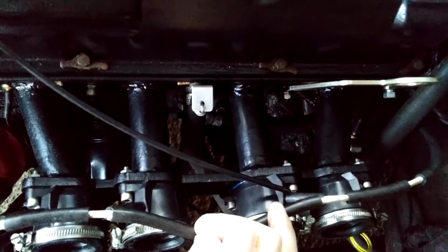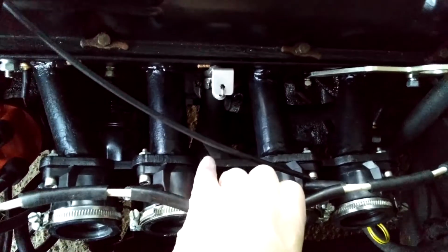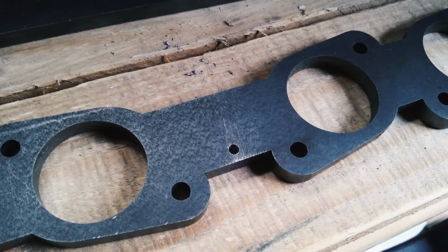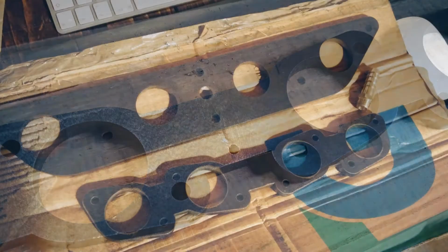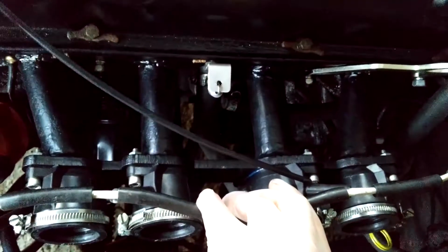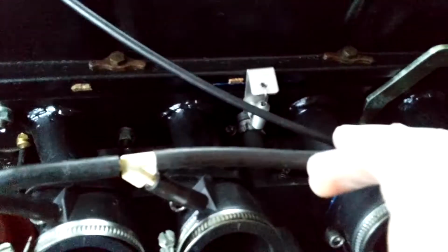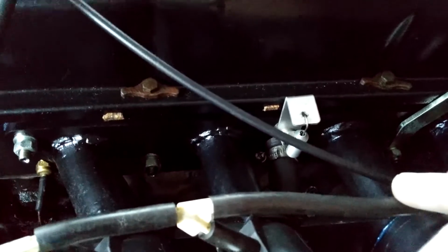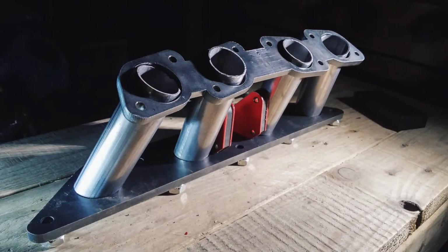I don't know if you can see maybe from above. I'll put some pictures up as well just to show. So this flange is one piece that mimics the face of the cylinder head where the original carbs would bolt onto the motorbike, and then that leads down to a flange that bolts onto the Pinto cylinder head. Basically I tried to do it with just straight pipes rather than a dogleg kind of bend.